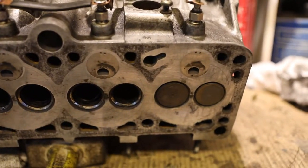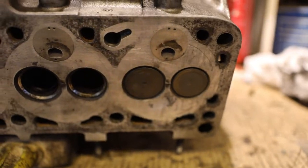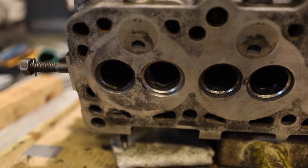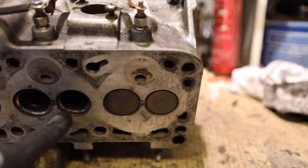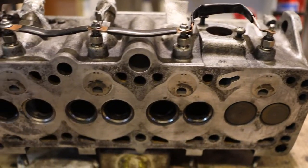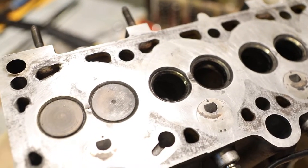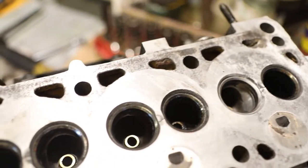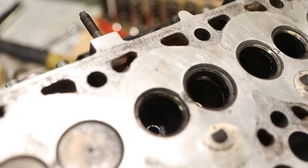One of the reasons we took the valves out was because between the valves we've got these little cracks, and they seem to be between each valve. So we want to take the valves out and have a look inside, see if the cracks go up inside. So here's a better view of these cracks on the bottom of the head. And I've taken the valves out to have a look down in between them so you can see any cracks. So far it looks like we don't have any cracks,